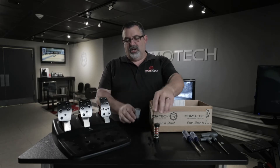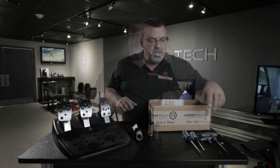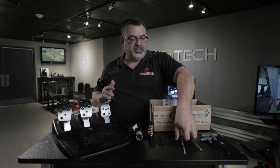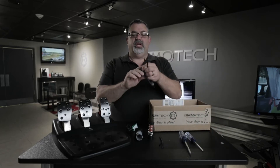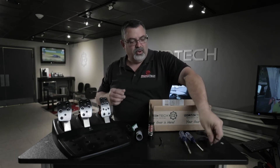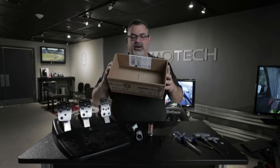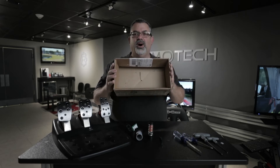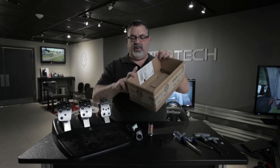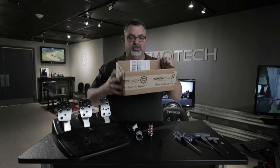It also has a softer feel and a little bit more travel than our version 2, and in this video I'm going to show you how to install it. A few tools you'll need: a number 1 Phillips and a number 2 Phillips screwdriver, a 2.5mm and a 5mm Allen wrench — a simple L-type will work. I also recommend a cardboard box about 12 inches wide (300–320mm) and about 6 inches by 4 inches deep (150mm by 120mm tall).